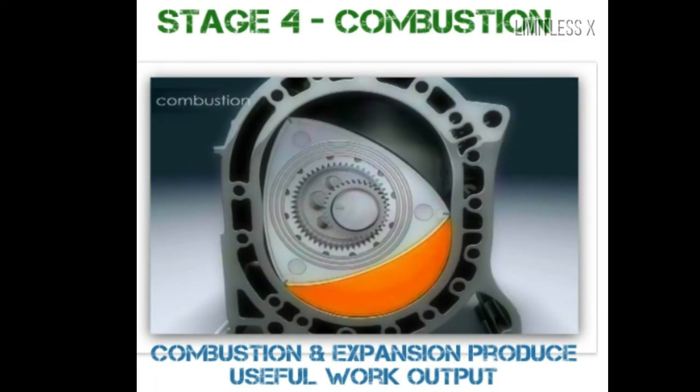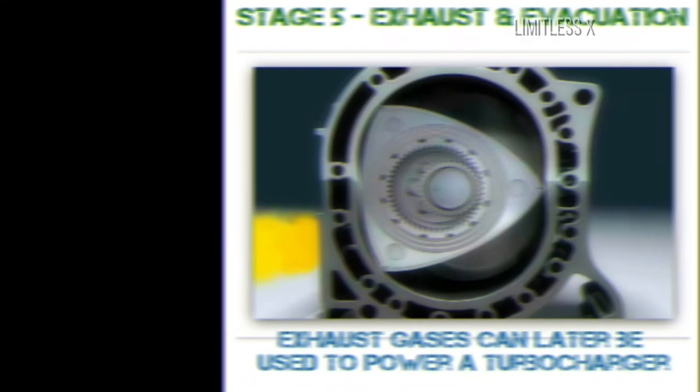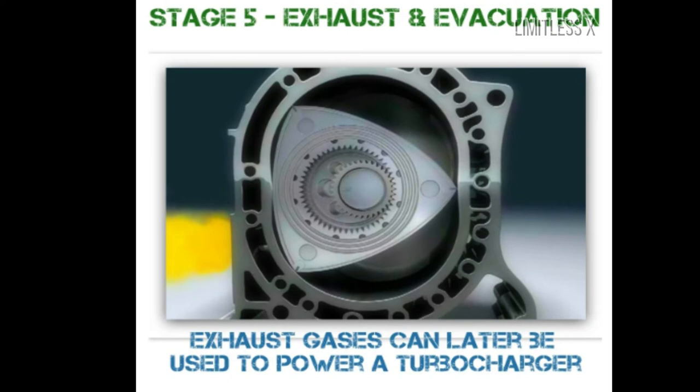Exhaust — expansion of volume at constant heat: Due to the immense pressure resulting from ignition, the rotor moves to allow for expansion. While Vertex 1 and Vertex 2 have moved to expand, Vertex 3 assumes a position suitable for induction. Meanwhile, the exhaust port between Vertex 1 and Vertex 2 allows for the expulsion of spent gases, making this a continuous cycle.